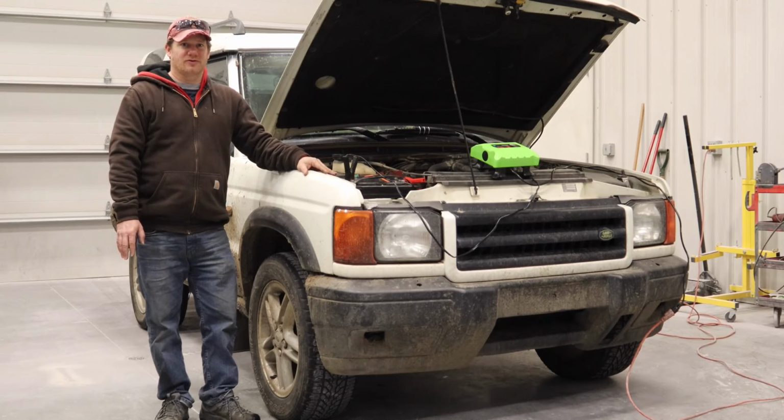The other white Land Rover Discovery II you saw, I did put a new XYZ switch in it, and that fixed all the problems with the transmission. Was driving it for about a month or two, and then I decided to program a key fob so that it would have keyless entry, and then the truck would not start no matter what I did after that. I did put in another matched set of ECUs and BCUs, and it still won't start, so I'm going to just take parts off of that truck for now to get this one fixed up.